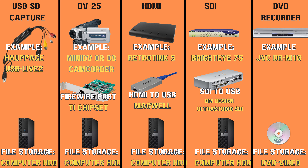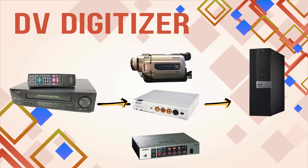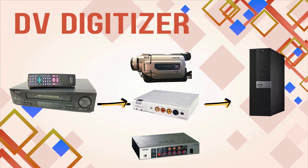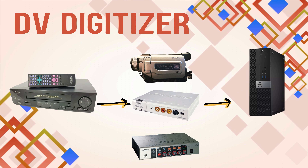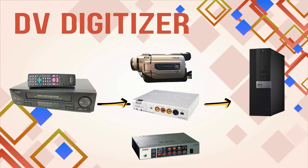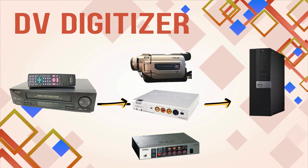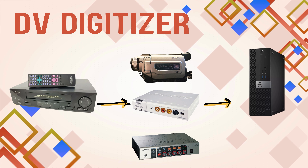There's also the DV25 workflow, which involves using a MiniDV or Digital8 camcorder to digitize your tapes. This doesn't mean you're playing your VHS tape inside the camcorder — that's not possible. Instead, you're using the circuitry inside that camcorder, or something like the Canopus ADVC box, as a kind of bridge. The VHS deck sends its analog signal into the camcorder, which converts it into DV that you then transfer over FireWire. I find this workflow one of the easiest to use — the files tend to be smaller, and while DV does compress color, in practice it's a pretty solid contender when you factor in the ease of use and quality.